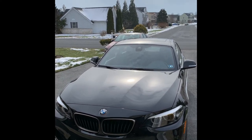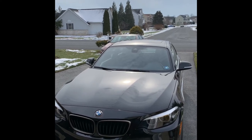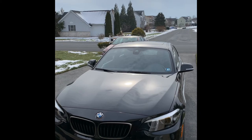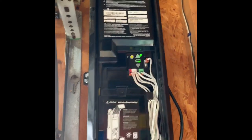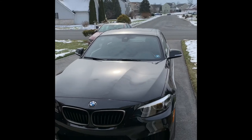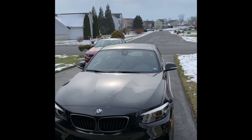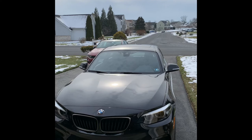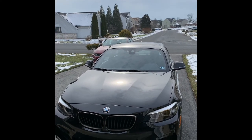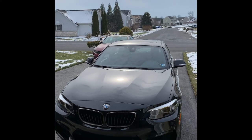First thing you need to do is learn the remote control to your car's HomeLink — follow those instructions. After that is when you come to the learn button on the garage opener and press that to activate the learning mode. Then go back to the car a second time after you have programmed your remote control unit, and allow it to learn the rolling code so it will open. Every video I watched did not specify that, and the instructions were not clear.